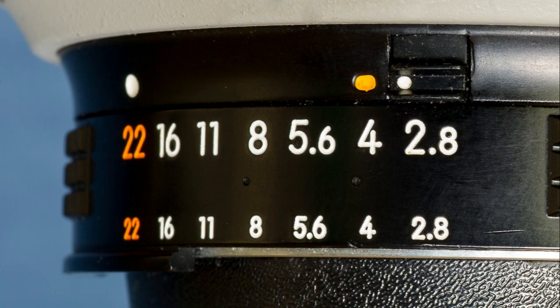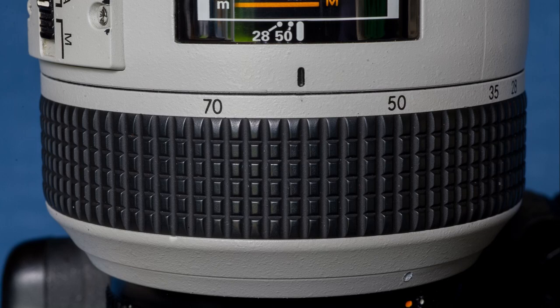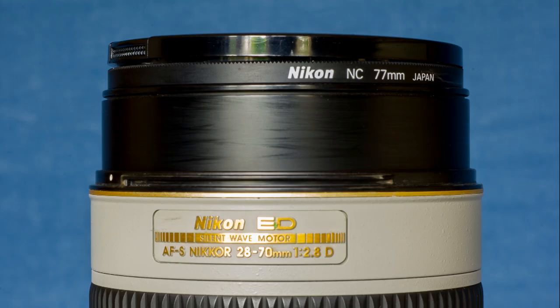Starting our tour of the lens at the lens mount, we're reminded that this is one of the earlier AFS lenses with its mechanical aperture ring. It also has a tiny switch to allow you to lock it into the minimum aperture position for camera bodies which set the aperture electronically. Next along the lens is the generously sized zooming ring with its firm but positive action. Like many of Nikon's professional zoom lenses, the entire zoom range is packed into about 90 degrees of turn, making zooming a speedy business. Although it's easy enough to turn with one finger, it's clear that it's moving quite a few elements inside the lens, and the lens gains several centimetres in length as you zoom out to the 28mm setting.